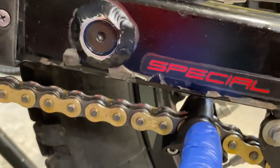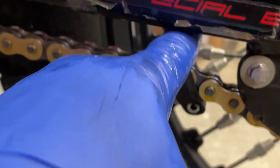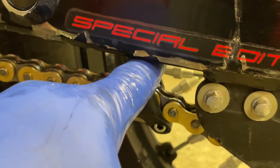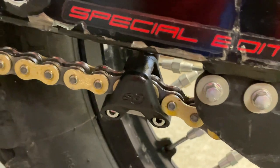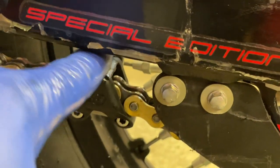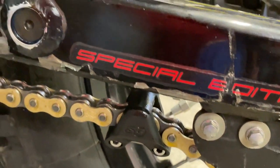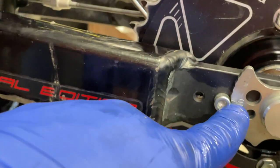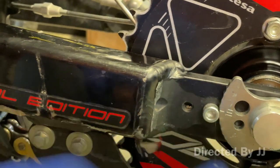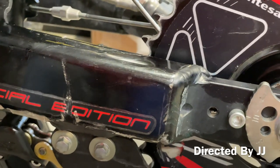Also, the way I set up the tension of the chain is basically by putting a finger on it. My understanding is it should be between 1 and 1.5 centimeters over there, so my finger is about this much, maybe 2 centimeters. So I just put it on and I feel that this is okay. And obviously on both sides, the number 10 is going to be a little bit more on the top part, and then make sure that the wheel is nice and centered. Okay, super.